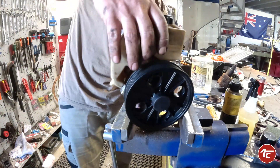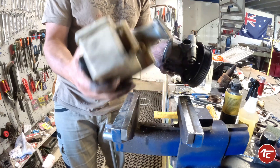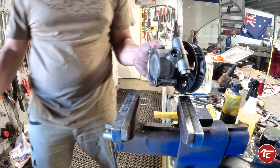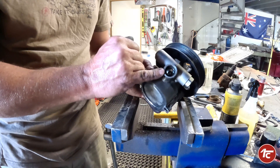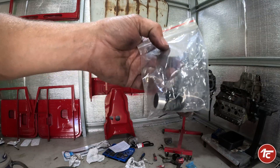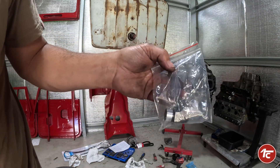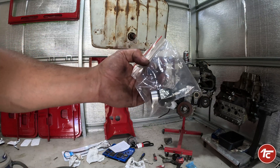There we go — it's just a plastic sitting in an O-ring, so you can see why they were probably prevalent to leaking anyway. That can go in the bin. They supply us with a new fitting that we need to put in the freezer for an hour because it's a shrink fitting. I'm going to put the fitting in a bag and chuck it in the freezer — I'm not physically touching it until the very last minute, because even body heat will change the temperature before we fit it to the power steering pump.